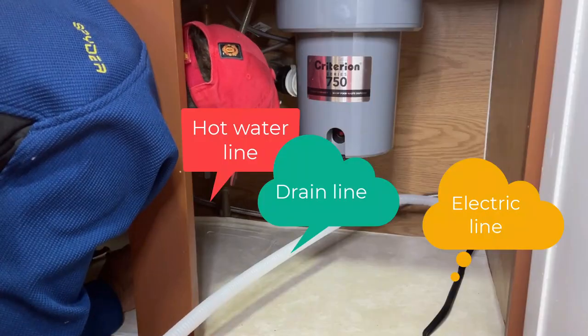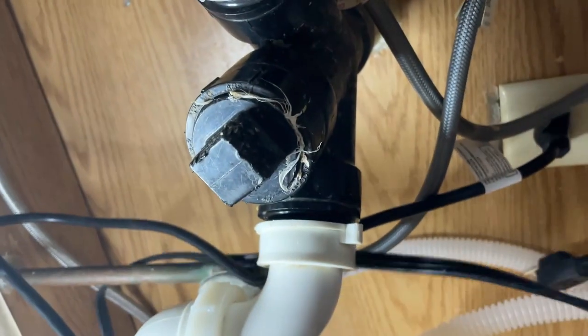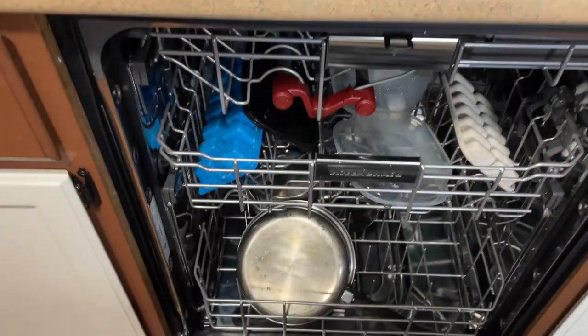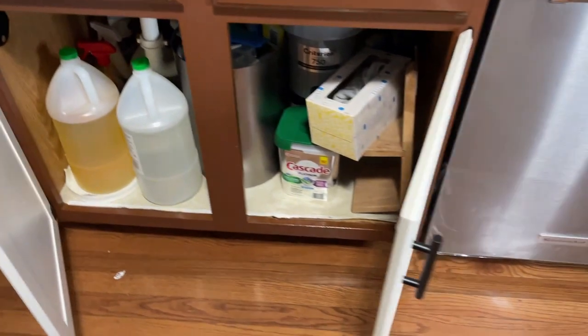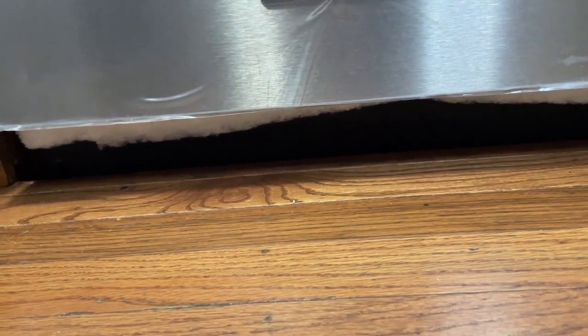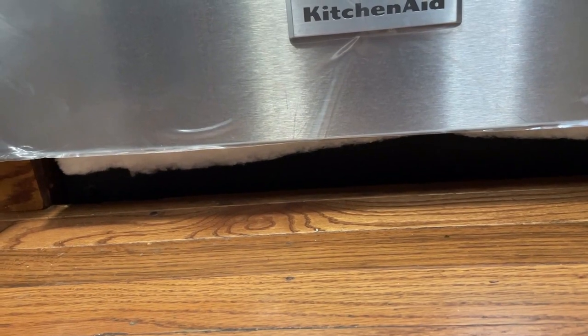The handle is in, this is the drain hose, this is your hot water line — now you're ready to put the plug in. After the installation, when you start the dishwasher — I was able to do a dishwashing last night — but make sure when you do the dishwashing for the first time, you open your cabinet and keep an eye on any water leaks. Also, if you look underneath, this is your cover here — you can open this cover and observe any water leaks in here. Make sure there is no water leak after the install. Hope this video helps you with your installation. If you like the video, hit the like button, please consider subscribing to the channel and turn on the notification. Bye.